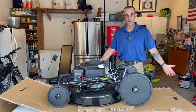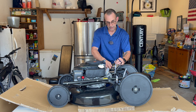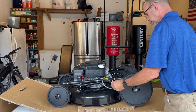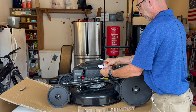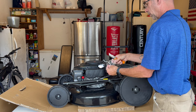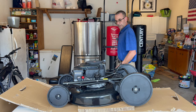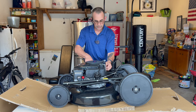So this is how your mower is going to come when it's in the box — you can just pick it up out of the box. Cut your zip ties off. Here's your gas cap with a little twisty on it. Remember, you have to put oil in this thing. Please don't forget to put oil in your machine. Take off all these little stickers, all these little tags and safety items. Right here it tells you put oil in it.